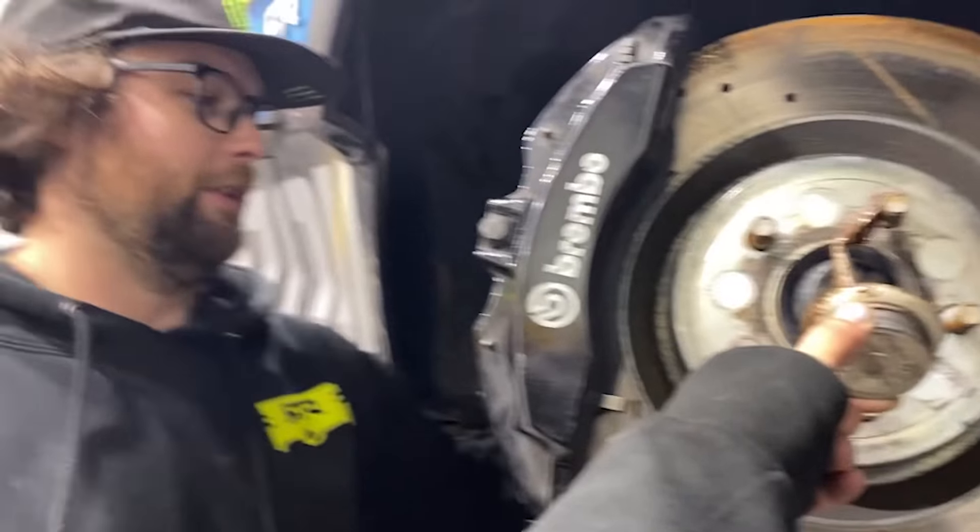They're 4140 steel and they just go into this slot where the tie rod is, sliding in to position the tie rod location for the Ackermann. Then the top hat design relocates the strut to get the proper amount of wheel clearance and caster. It also holds a spring seat, which I might actually end up changing to a mono ball bearing design after we test it.